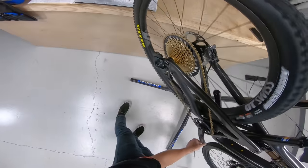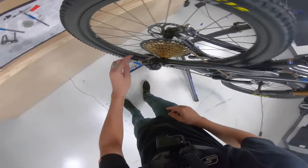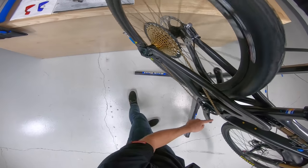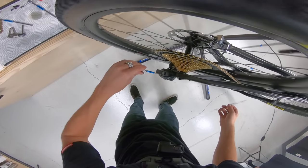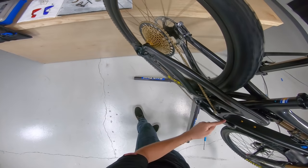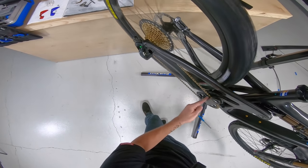I just got a little bit of movement by tightening that in. I want it tight enough so I'm not going to shift over into the wheel, but not too tight where I can't shift into the gear. That looks good. I'll try a quarter turn more — now I can hear it's fighting itself. That was too much; backing it off a quarter turn. Still fighting a bit, so one more quarter turn. That's better.